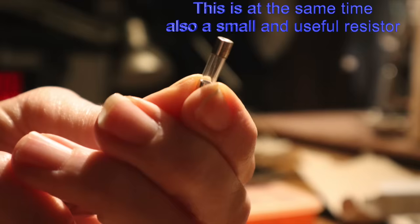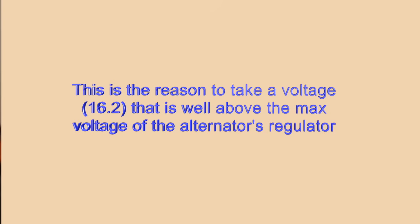A fuse can protect a failing diode that becomes a short circuit and which would cause a domino effect with the other diodes, but then the protection will not be active anymore and the whole supercapacitor is at risk. A well-chosen combination of normal and Schottky diodes ensures that the voltage stays below the 2.7 volt limit per capacitor, and the lower voltages of the Schottky diodes will allow you to be pretty precise. And a LED can help to monitor the voltage.